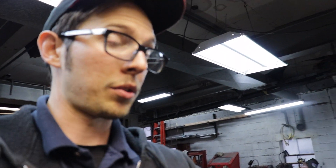So we have a leaky turbo there, my friends. It started blowing out the bottom plug but as soon as it did, it also blew right out of the wheel there - that's telling me the seal on the turbo is faulty. So what I'm going to do is take the turbo off the silver Subaru outside and throw it on this thing, and that should solve my problem. Not saying the motor isn't hurt either, but I don't see why it should be. At least now we know this turbo is faulty and needs to get rebuilt or replaced. I'm just going to scavenge the one off the other car for now. That's how you check your turbo for a leakage - take it easy boys and I'll see you on the next one.